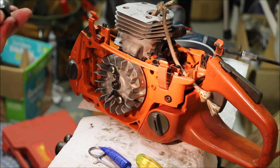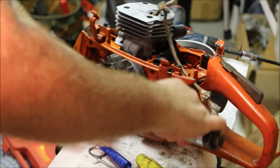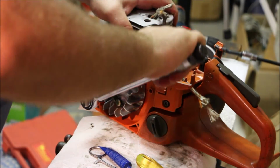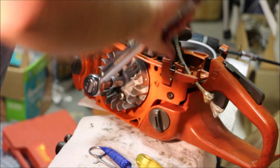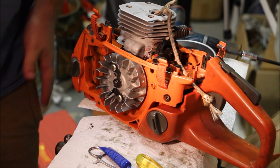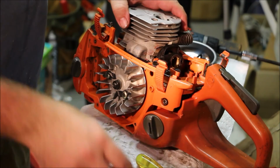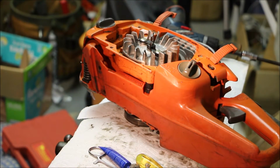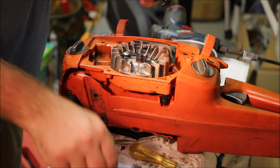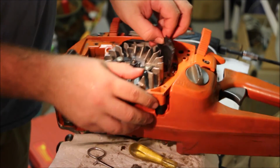For these little guys, I use 13 foot-pounds. If somebody has a better spec, they're welcome to correct me. Always the torque wrench. Good. Back it off. Pull your piston stop out. Let's put the air jet in here. This air jet right in here. Up. Blue Loctite. The air jet goes in here.